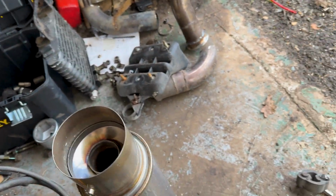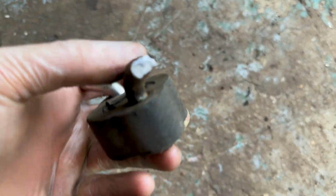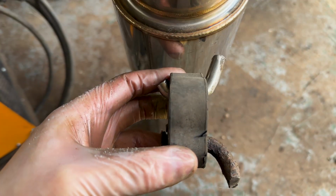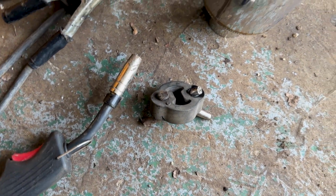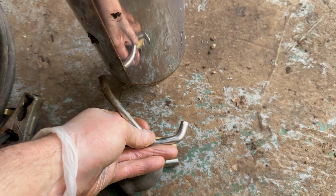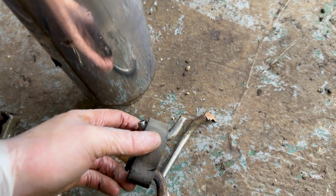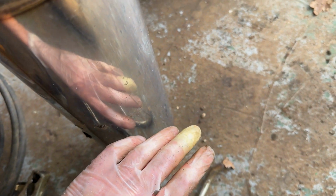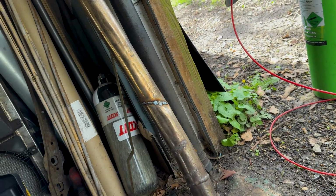So I'm going to tack, here we go. I'll tack that on the inside somewhere, then that can just tack somewhere on there. It's some sort of angle or something. Just get it to sit, and then I've got this longer hanger, which I'll do lower, nearer the bottom, and then a hanger inside the car. So I'm going to set up the GoPro again, get time lapsing, and get the silencer in place. Then once the silencer is in place, I can finish off the downpipe back.